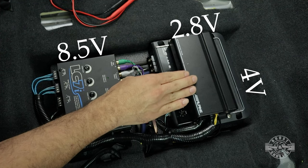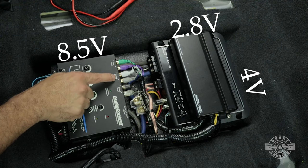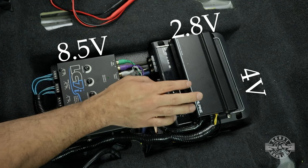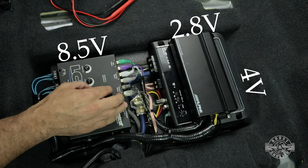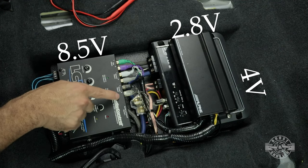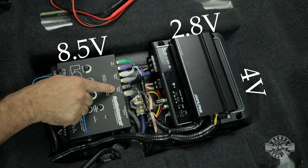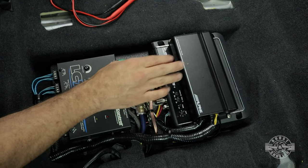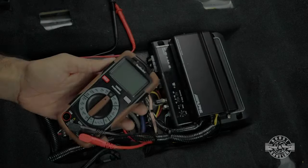In fact, this amplifier has an input sensitivity maximum of 4 volts, and this inline amplifier is even lower at 2.8 volts RMS. So what I want to do is adjust these three channels so that they don't put out more voltage than what the input of these two amplifiers can handle. I'm going to make sure the output is as strong as it can be — as close to 4 volts and 2.8 volts as possible. The higher your source voltage coming in, the less sensitive your amplifiers have to be, which cuts down considerably on noise.